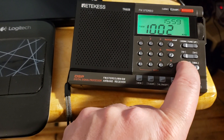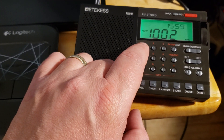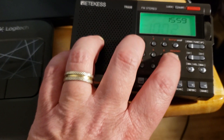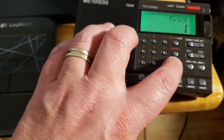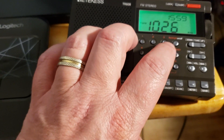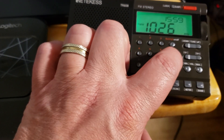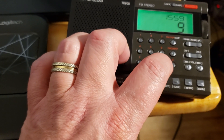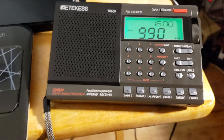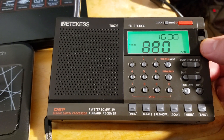What you need to do — once again the volume is maxed out — is tune a frequency where you land on a correct 10 kHz increment. Let's try 1030: that shows 026, so that one's no good. Let's try 990 — yeah, here we go. And now you can finally tune your radio in 10 kHz increments correctly.